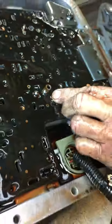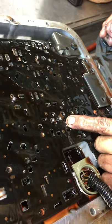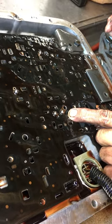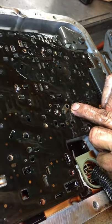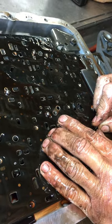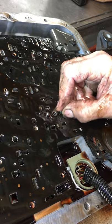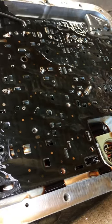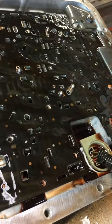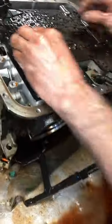If you notice here, we have one check ball that has two big holes. This check ball is really critical in this transmission — it controls your reverse and your forward clutch apply. If you left this check ball out and put it in drive, it would apply the reverse hold clutch too. Same way, if you put it in reverse, it would apply the forward clutch. So this ball switches back and forth to block that from happening. You could basically leave all the other balls out and the transmission would shift hard as a rock, but if you left that ball out, the transmission wouldn't even leave the parking lot.